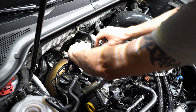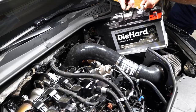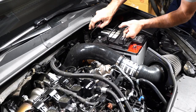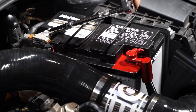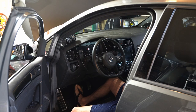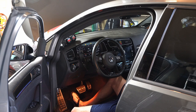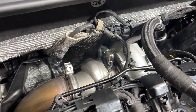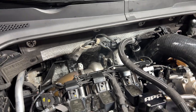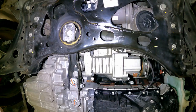Now I can tighten down all my connections for the oil feed line and go ahead and put in my coil packs. I didn't pull the spark plugs yet because I know I'm just going to do a test run. I've still got to put on multi-port fuel injection and change spark plugs, but right now I just need to test that turbo and make sure I don't have any leaks and everything is connected. Now I'm just going to let it come up to operating temperature. It is going to probably smoke the first time - number one, you've got oil and coolant residue from removing the turbo, and then junk on the new turbo is going to burn off. Now we wait and check for leaks.